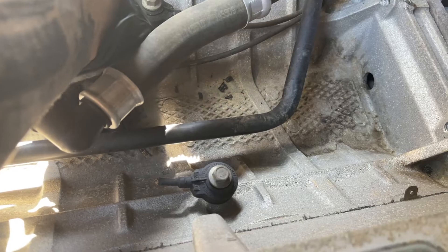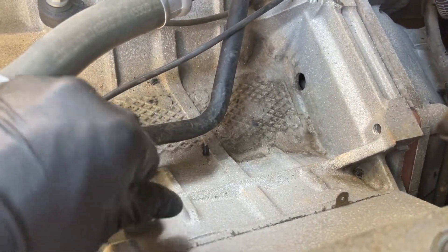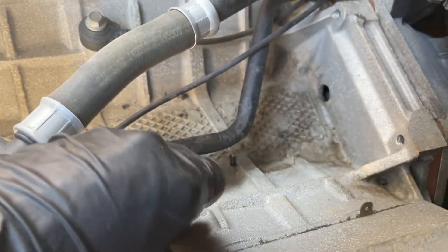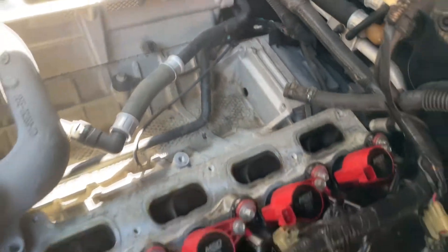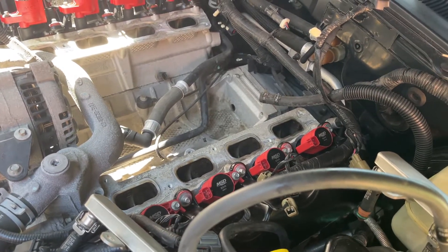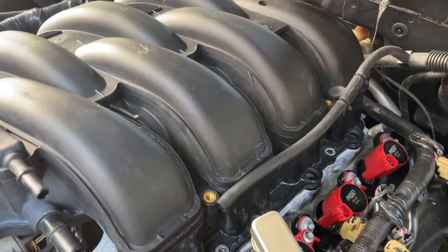When it's really hot, some of these from the factory ended up positioned right here, touching up against this pipe, and it has the potential to melt the insulation on the wiring and cause it to eventually corrode and fall apart. I think that's probably what happened, but I need to take this apart and really analyze it — see if maybe a rodent bit into it, though then you'd expect all the other wiring to be damaged too. Anyway, the part already came in so I'm going to go grab it and put it back together.